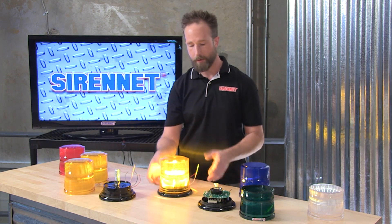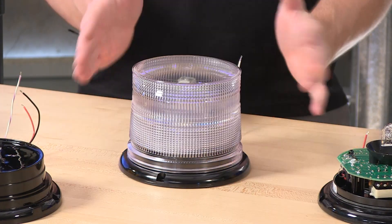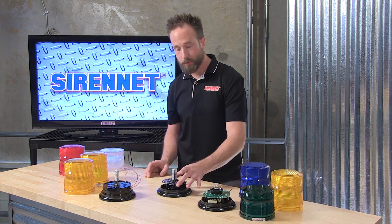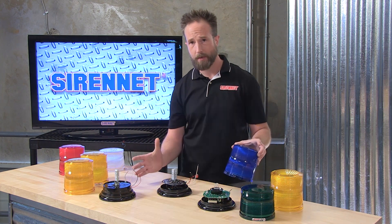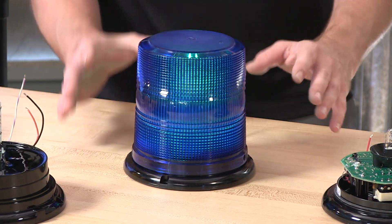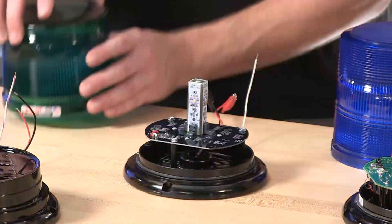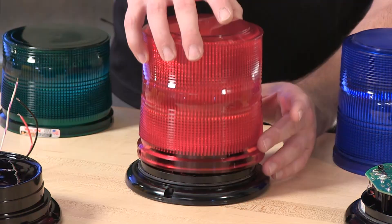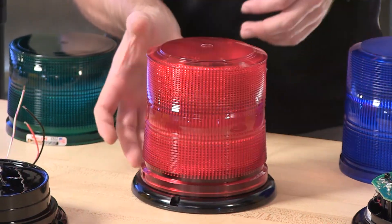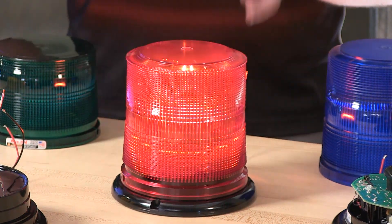With this, I could switch over to a low profile amber dome if needed, or go ahead and fit it with a clear. There's a bit of a difference between the two domes — moving from the clear with the amber inside to the amber dome matched with amber. Something that's not available when doing a dome transfer with the LED system is that the diodes are producing the colors — it's like a crayon effect from back in school. Take a blue dome: dramatic intensity drop and very odd color output. Green affixed on top: a little bit of a yellow look. And lastly, with the red dome — it does have a good increase, but with the amber going through the red, it does have a decrease in intensity versus a red tower or a white tower going through a red dome. But if you needed to make a quick switch on the fly, it could be done.